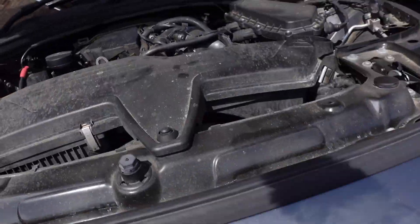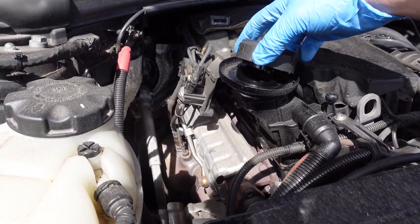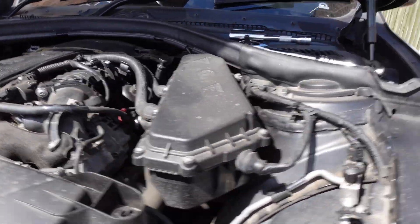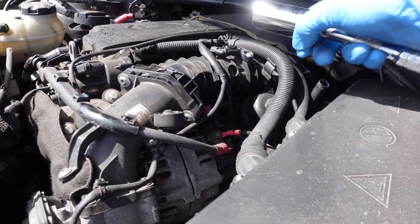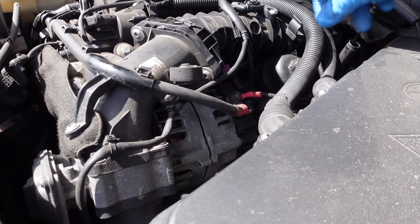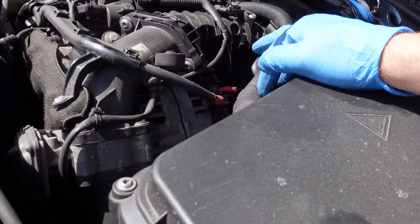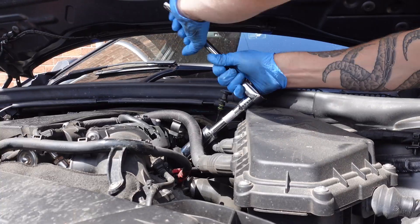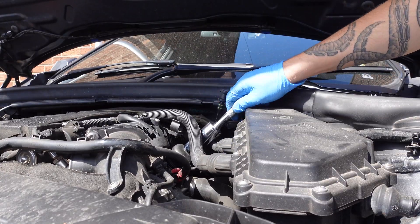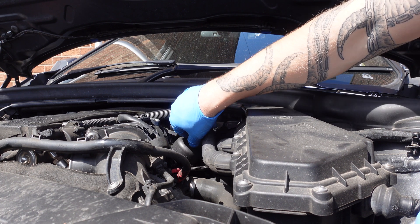While that's draining, to help it drain we're going to do something up here — I'm going to take the engine cover off. It just pops off with the rubber things it's got. I'm going to pop the oil cap because otherwise it ends up like a vacuum and holds the oil a bit. Pop the oil cap, pull the dipstick, and now use a 27mm socket or adjustable spanner to get the oil filter cap — that's where our oil filter lives. This is going to help all the oil drain out of the filter housing so we can get as much of the old oil out as possible.